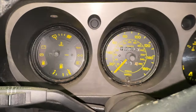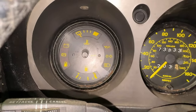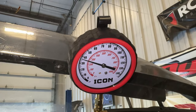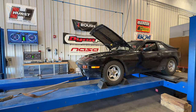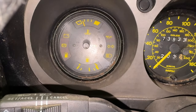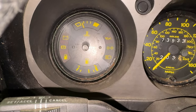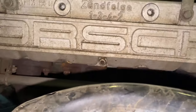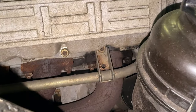Since I think the problems might be temperature related, I'm going to make a run right now with the engine fairly cool. We have close to 40 psi fuel pressure right now. There's a lot of smoke coming from up front, and I also saw the low voltage light popping on as well. I think the smoke is oil burning off of the exhaust manifold on that cylinder — all the rest look dry. I hope there isn't a problem with that piston.